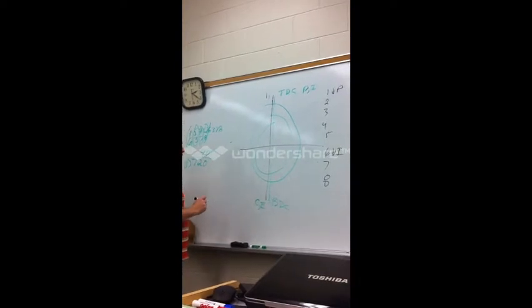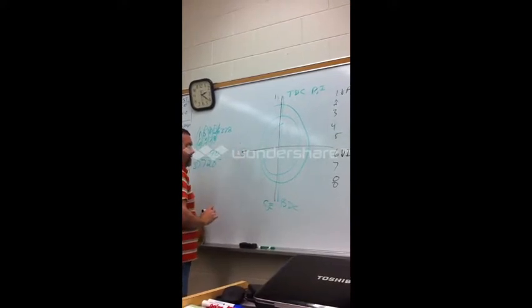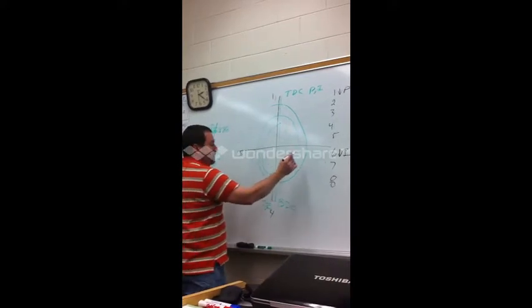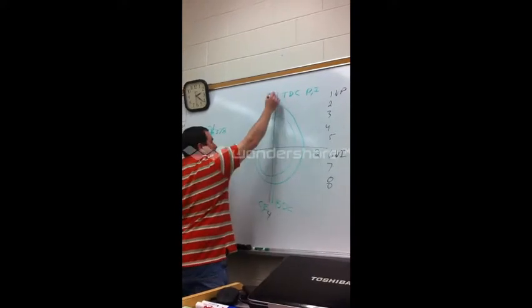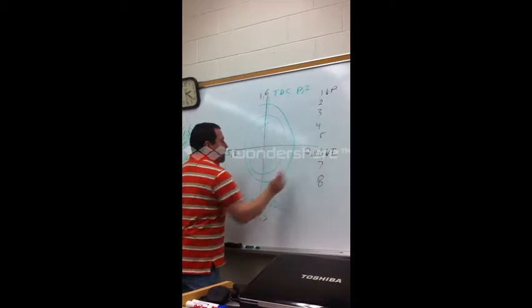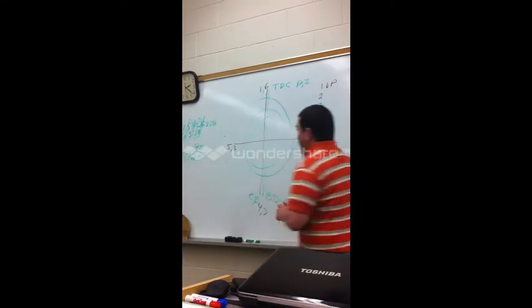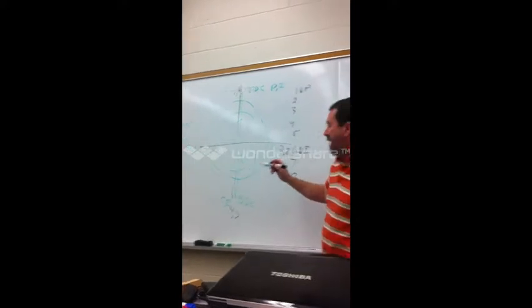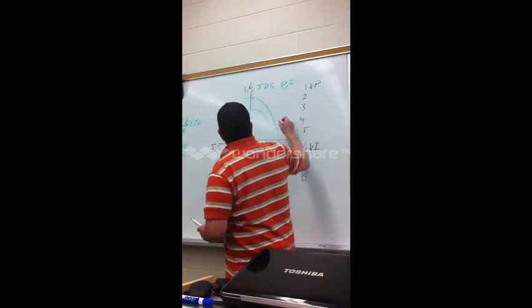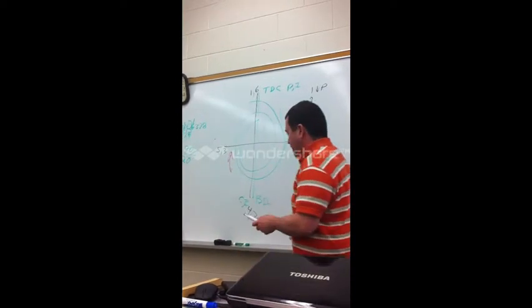What's next in the firing order? Where's five go? Next. Okay, so if number one is on power, the next in the firing order you said is five. We said that on this side everything goes down, on this side everything goes up. So the next in the firing order is five.